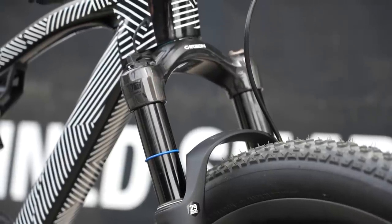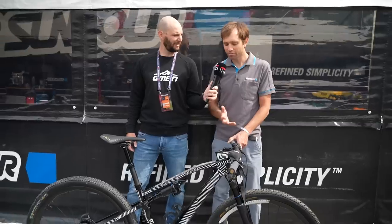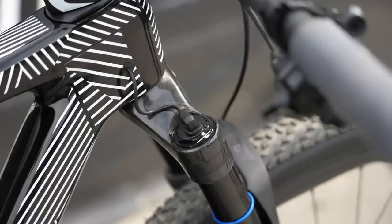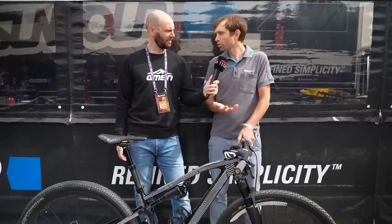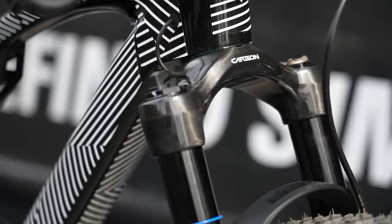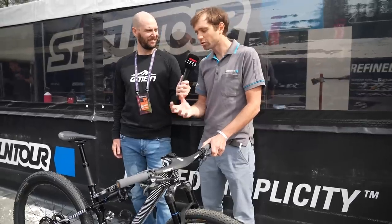The sensors detect what the track is like and very fast adjust the damping of the suspension between one of these three positions to choose the best one. It's got various accelerometers and sensors so the rider doesn't have to adjust anything on the handlebars — it does it with its own brains. We have a microcontroller inside with sensors that gather different signals, do a lot of post-treatment, and every millisecond it adjusts everything and asks the actuator to adjust the position.